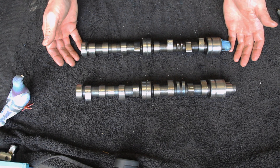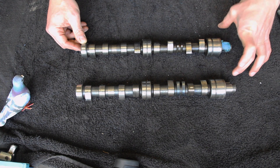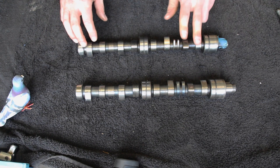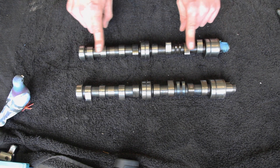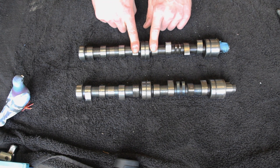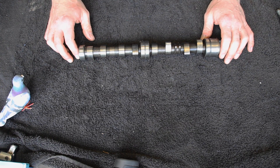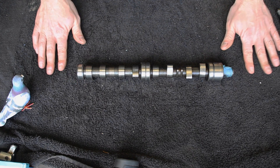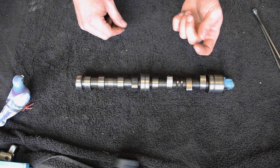To give you a rundown of a camshaft if you've never seen one: there are three bearing positions. One goes on the outside at the wheel end, your oil pump slots into the groove there, and each cylinder has a pair of lobes to open and close the valves. For positioning reasons you've got exhaust-inlet for the outer cylinders and inlet-exhaust for the two inner cylinders. So why does the rule of nine work? It may seem like an overall random array of lobes, but there is method to Rover, BMC, and Austin's madness. Inside the engine you have followers — they look like tiny little buckets.